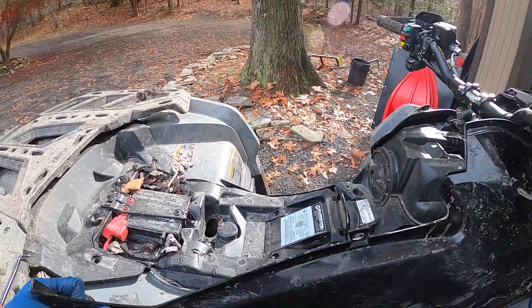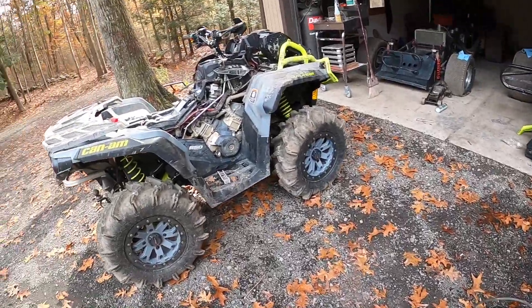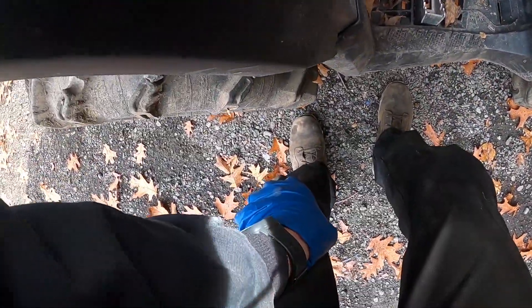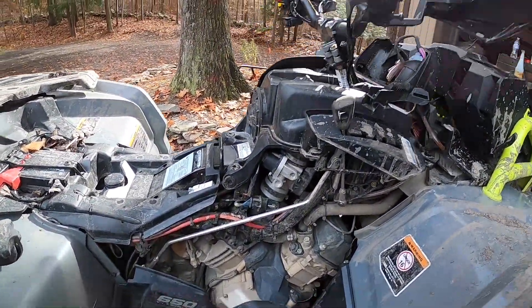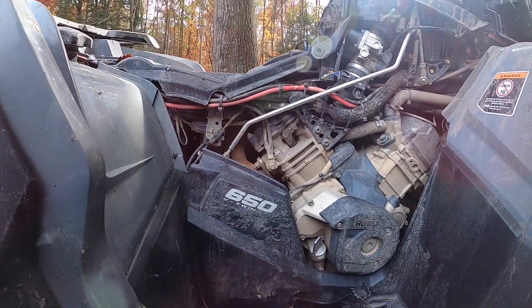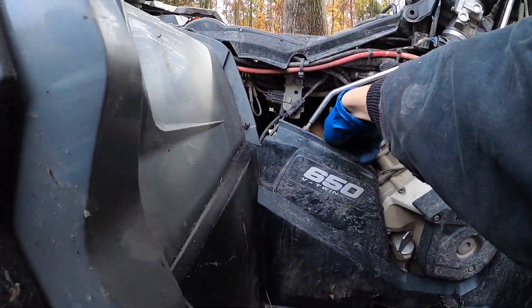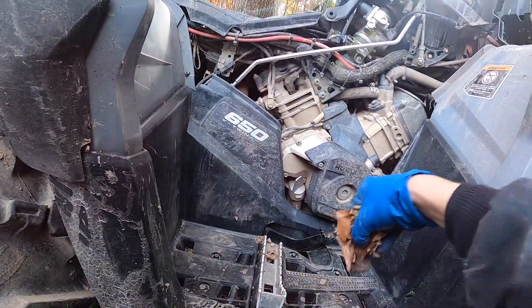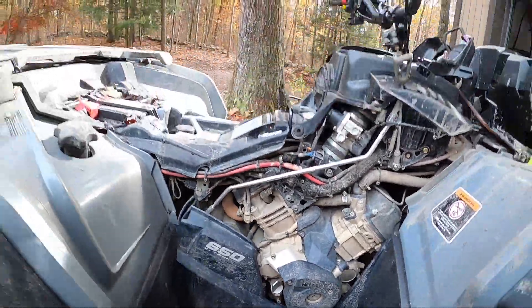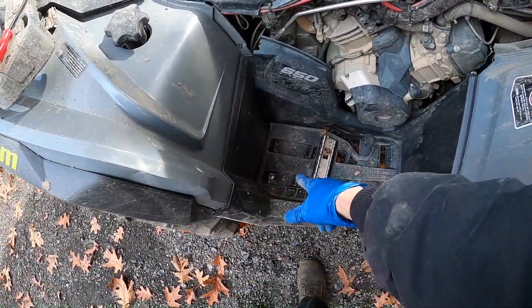This panel kind of folds out - first time you do this it does not come out easy, not going to lie. If your quad is brand new it does not like to come out. You can see all kinds of fun stuff in there - there's mud all baked onto the exhaust. I'm going to try to get that off. It's got some stuff packed onto the exhaust. I also have to pop off the other side, and we're going to be popping out the footwells because mud likes to get trapped underneath.